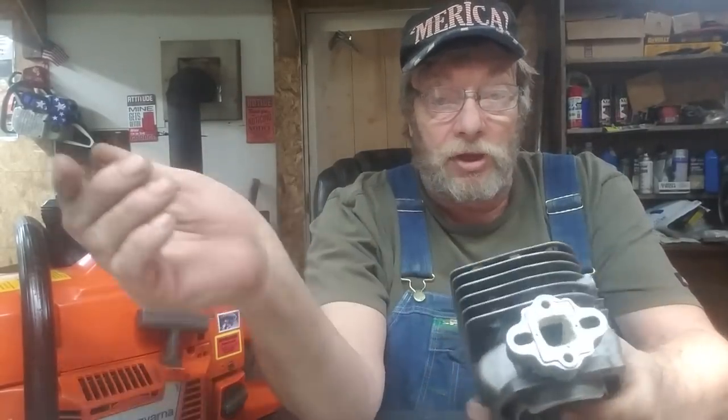Here's that reed cage — what do you think of that? Dirt bike stuff in it. That little sucker drops right in there just like that. Here's the little intake — goes on there just like that. All I gotta do is cut my factory rubber intake to the right dimension. My carburetor is gonna mount exactly in the proper spot that factory intended, so I won't have air cleaner issues or anything. Okay, so this is kind of next-level stuff, but it's not things you can't figure out on your own — you guys are pretty sharp, that's why. I watch some comments, I talk to some of you guys on the phone. You're intelligent as heck.